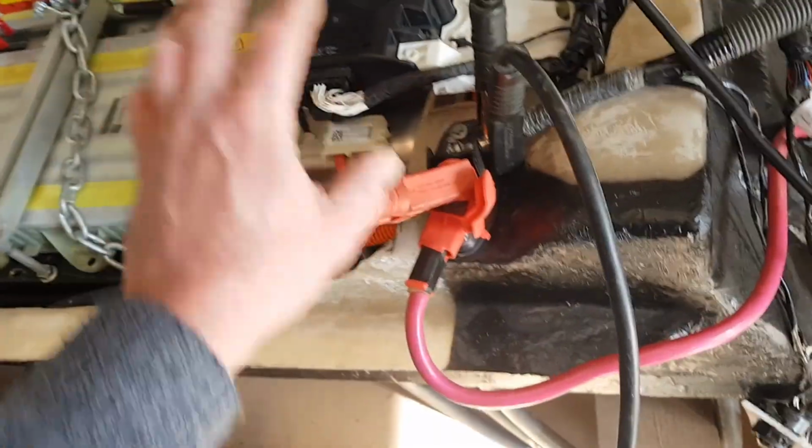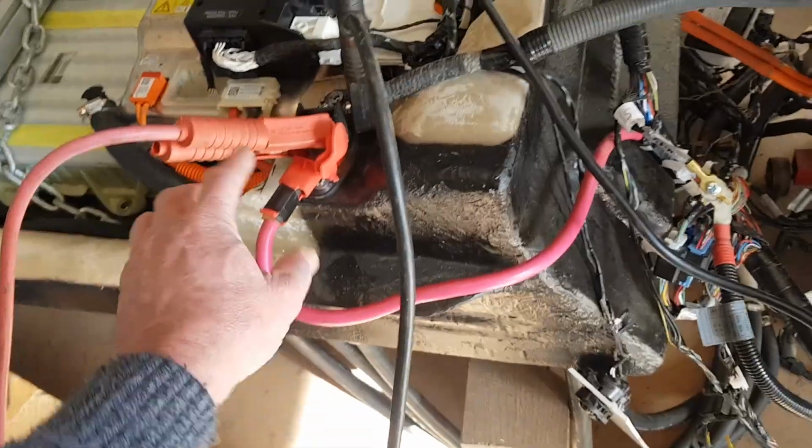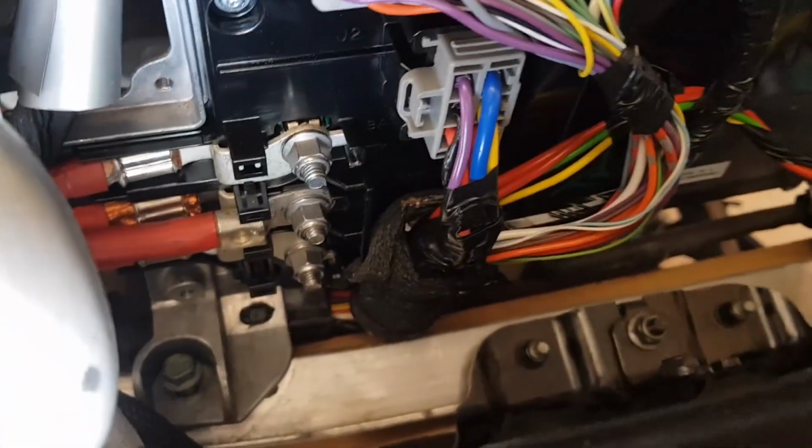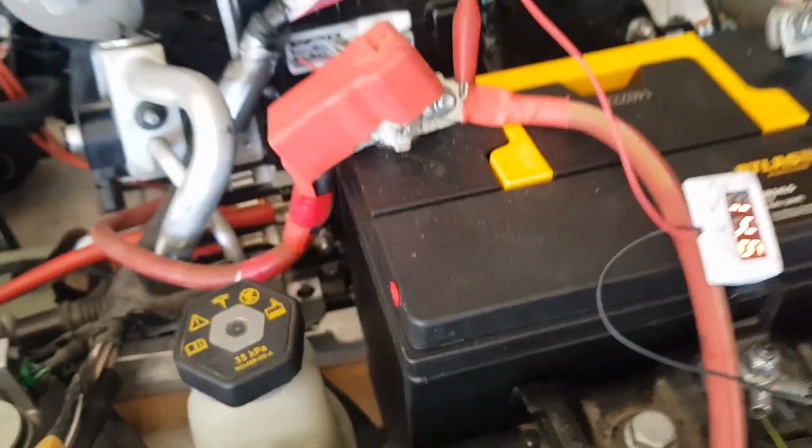He solved his because his battery is all mounted and this is all grounded into the chassis. He put an extra wire in there and that made his PCS go quiet. So these just go back to the ground up there. Now just listen. Take them off. It's the same if I take this one off too. It gets really loud and stops charging. Now I've got this going, an extra one going to VC front, which comes in there. You can see the original one underneath, and this is the new one on top. They're all up and running again.